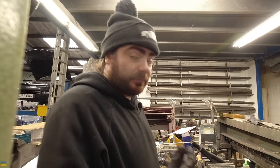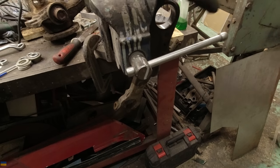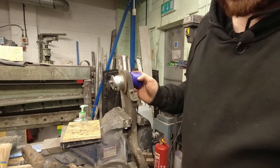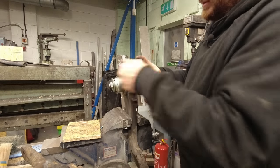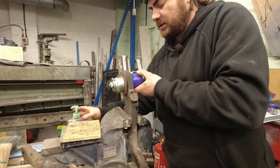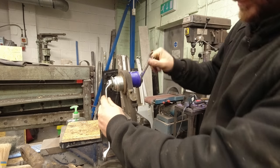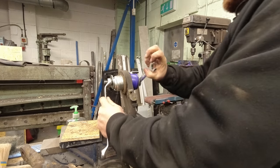So what I'm on now - I'm still technically taking things apart. We've got the wishbone here in a vise. I've removed the bush and cleaned that up. Going to see if I can put this in without ripping it to pieces. Based on all the grief I had with the other bush, I'm hoping this would be more straightforward. Just a bit of washing-up liquid in the gaps just to make it slippy. Yeah, the bottom's starting to go in - I think that's going quite well actually.